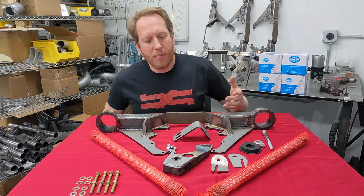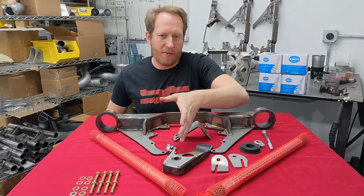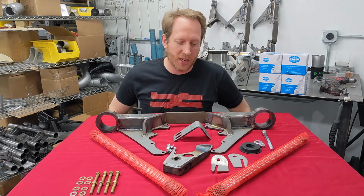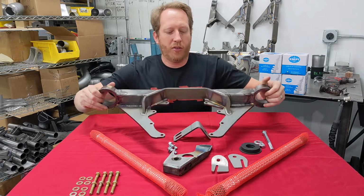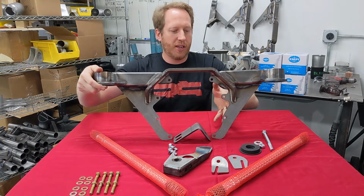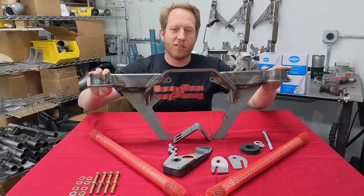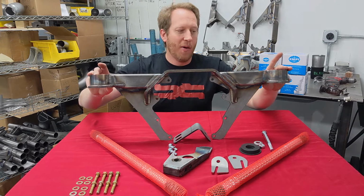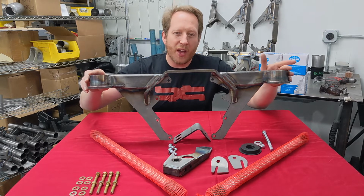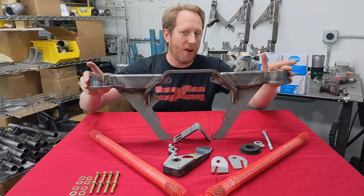The Mazda subframe has a vertical link that runs just outboard of the pinion, and the single-sided front mount, albeit a beefy, huge single-sided front mount, is really helpful for packaging. So the way this works is that there's a large cradle in the rear that bolts up directly to the housing on the pattern here at the cover. We're basically adding in factory mount points just like you would have had on an FC. You can use any kind of bushing you want back here that's intended for an FC. Personally, we really like polyurethane or maybe a Mazda comp bushing for a little bit of compliance. Compliance is important on this particular setup.